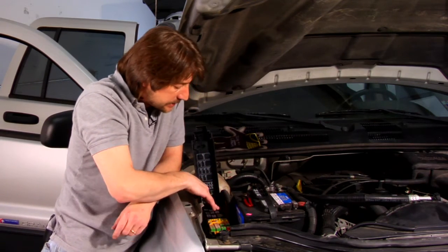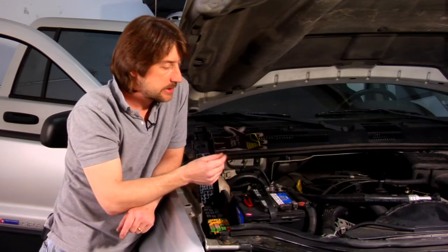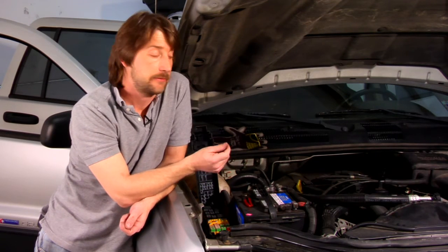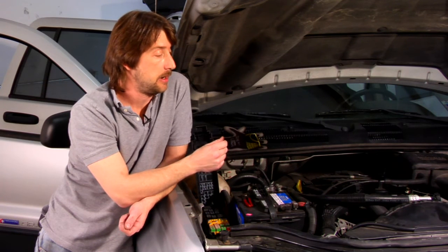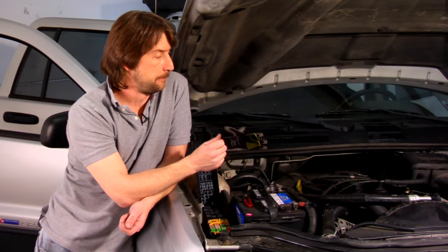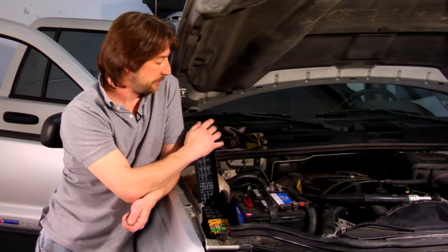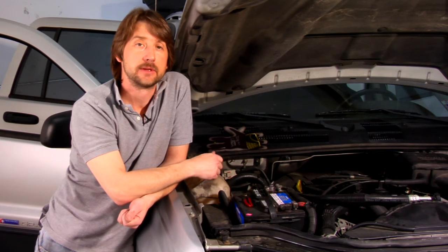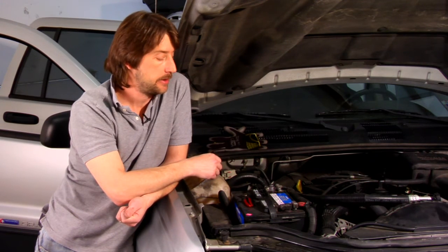The only thing I can tell you is the cooling fans — there's only two reasons they come on. One is if the temperature gets over usually about 240 degrees. The second one would be the air conditioner. If you turn the air conditioner on, ninety percent of the time the cooling fan is going to come on intermittently every thirty seconds or so. But that's the easy way to check and see if your fan actually does work — just start the car up, turn your air conditioner on, let it run for a couple minutes, and if the fan comes on, you're ready to go.